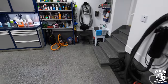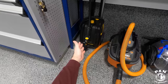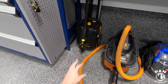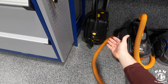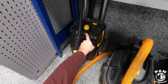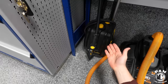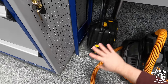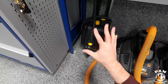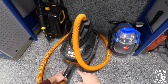For a steam cleaner, not much maintenance is needed on the exterior — just wipe it down with rinseless wash or APC. The key trick is on the inside: the water reservoir. Add distilled water only, not tap water, because tap water contains minerals that over time create deposits, gunking up the system and reducing efficiency. So only use demineralized or distilled water in your steam cleaner.